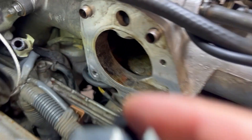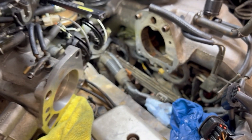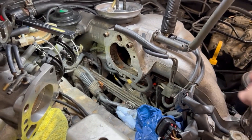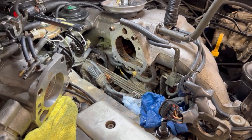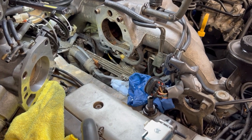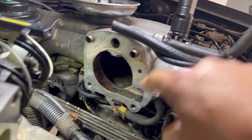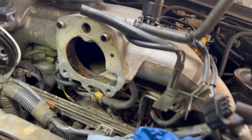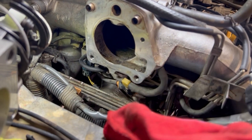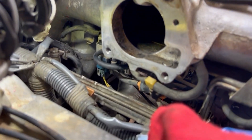I think that's one way to get to it, and it's easy to do with the throttle body out — you get access to it. It's easy to clean the throttle body and you don't have to take the whole intake manifold on top. What I did is I cleaned out the hole here inside, took this hose out and sprayed it — there was a lot of gunk in there. I took a rag in here and let it soak up all the carbon, so you can see it's a lot cleaner now.